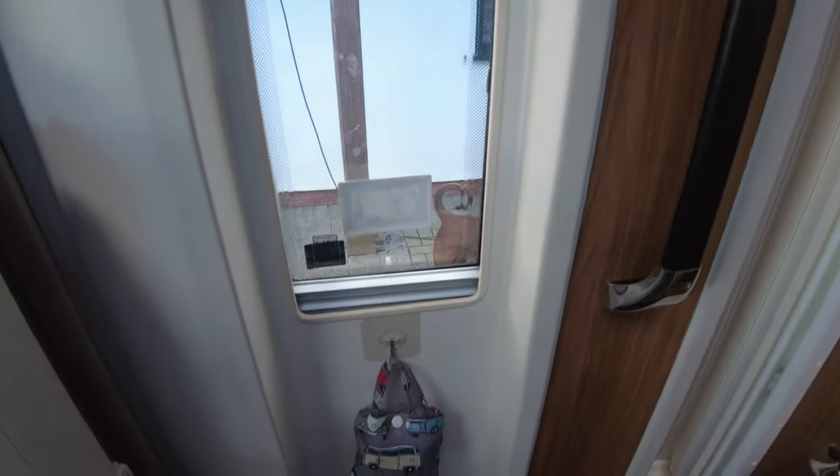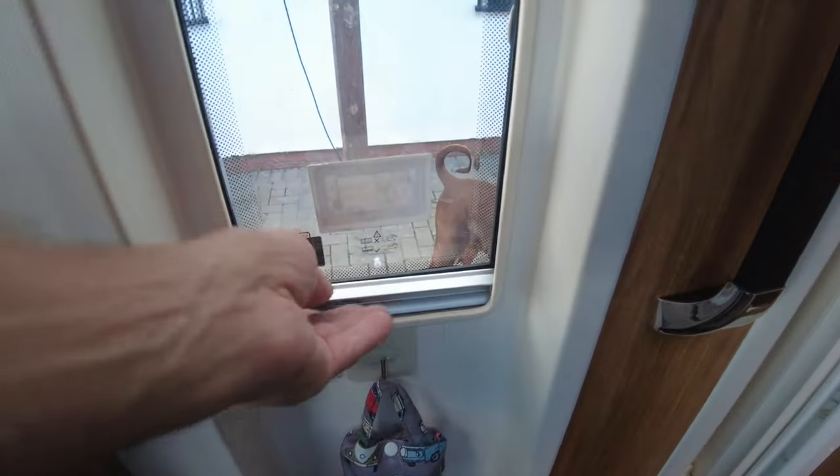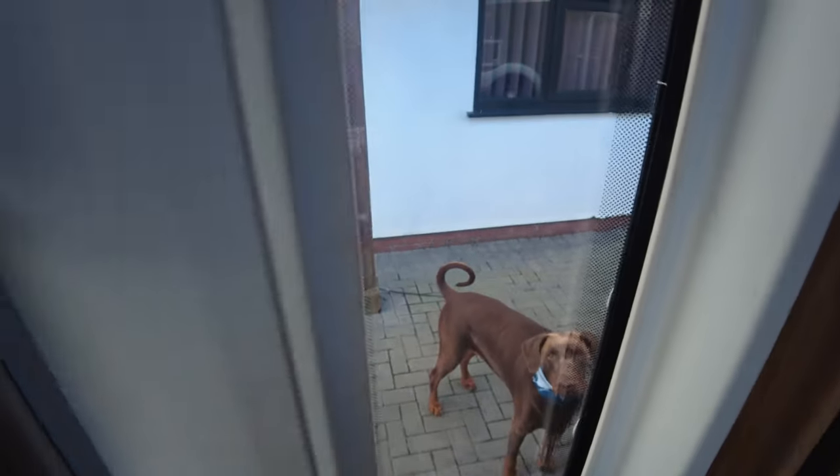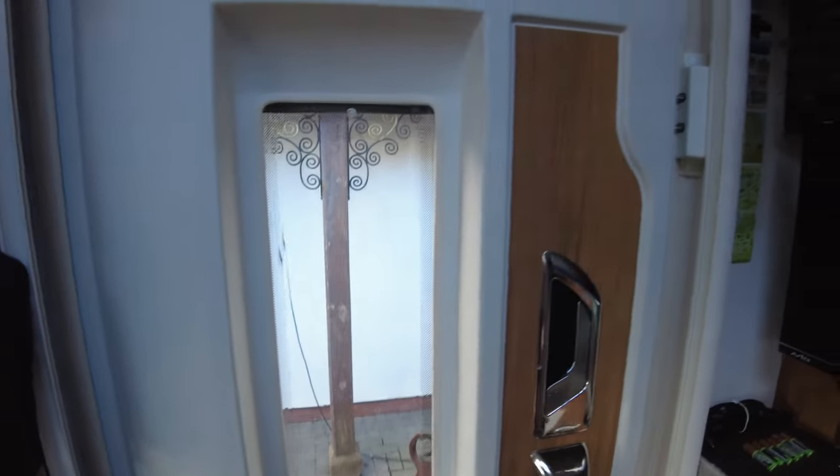Yeah, and then take the door off, or take the inner door skin off, remove the door blind window mechanism and re-thread it all with new paracord. So this is done after the fact. So if I grab the camera, so there you can see the door is now back on, completed, and we now have new slidey-slidey, or old slidey-slidey blind, but with new paracord.